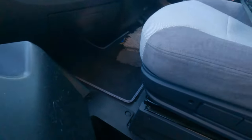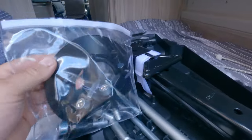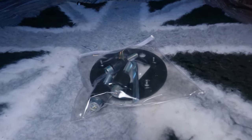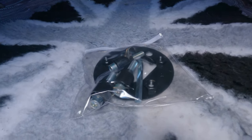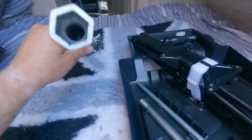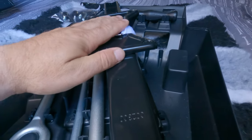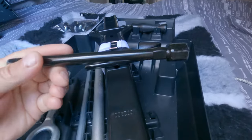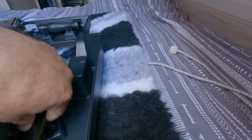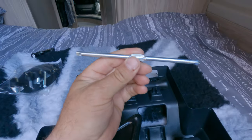Now that the toolkit's out we'll take it around the back of the van. Inside this toolkit you've got a plastic pouch with some bits and pieces — I'm not sure what that's for, so if anybody knows please share it with me. You've got a tow eye, a silver bar used to wind the jack up and down, a second silver bar used to loosen the wheel bolts or wheel nuts, and a scissor jack. You've also got a black bar that slots into the silver bar to wind the spare wheel down from underneath, plus a screwdriver handle and a double-ended screwdriver bit. So that's your toolkit.